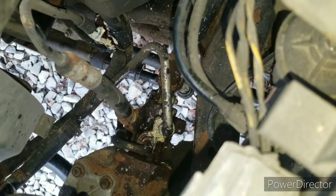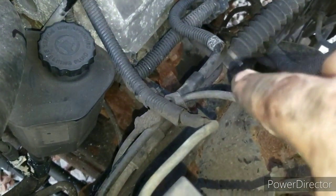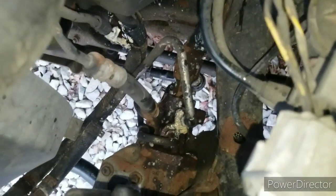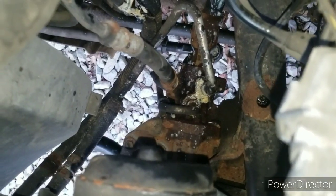Let's see. So if I pull it towards me, I think that's tightening. So I think I need to push away, because I need to take that bolt out so I can disengage the steering shaft. You know, this right here. So I can let the box out, because I'm replacing the upper, or the return line and the pressure line on the power steering hose.